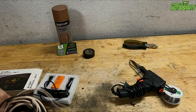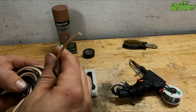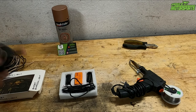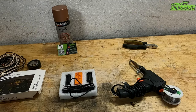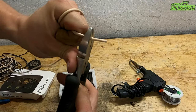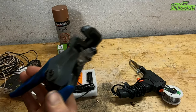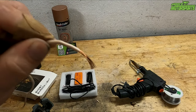We just need some wire. Now, 16 gauge to 18 gauge wire would be okay for this, but I have some 12 gauge wire here that I'm probably gonna use because I already have it, might as well. And some electrical tape, if you want heat shrink to go over the connections. I recommend that. I don't have any currently, but I like to wrap some electrical tape around it just to keep it from touching. Now, you can use some wire strippers like this, which I just basically do it like this, and it strips fine. Now, you can also use wire strippers similar to this, which work the best. I will link some similar to this in the description, and this just strips them really easy.